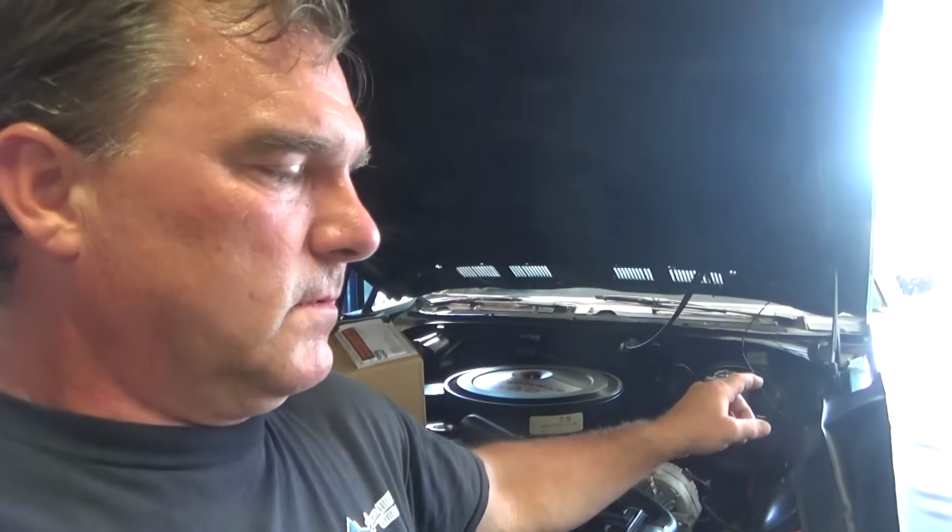I had the front suspension out of it. I did new coil springs, new upper control arm bushings. And I had not ordered my lower control arm bushings yet because in '70 they could be round rear bushings or oval rear bushings, and I didn't know which one it was and I hadn't looked at it. So having them out, I was able to clean my control arms because they were covered in grease, like the layers of grease on this thing were pretty ridiculous. But I got the control arms cleaned up, I got the knuckles kind of cleaned up, I knocked a bunch of the layers of grease off of it. And so next, I just put the lower control arms back in loose so I can check my ride height. And I am pretty happy with the ride height on it. Turned out looking pretty good.